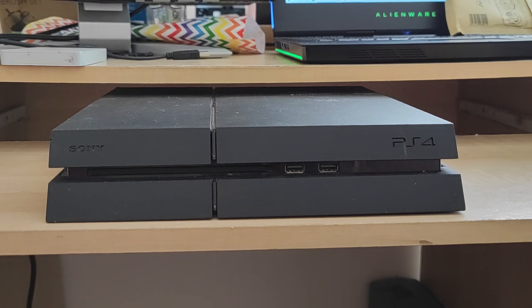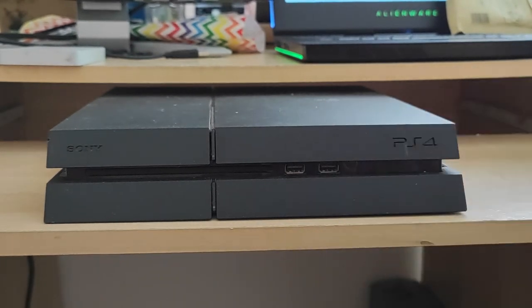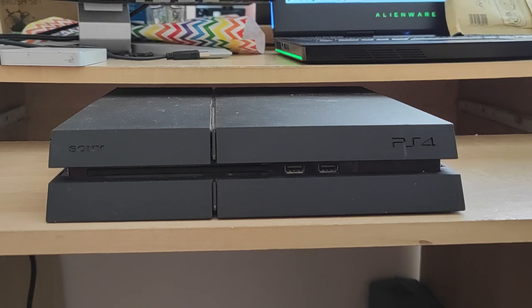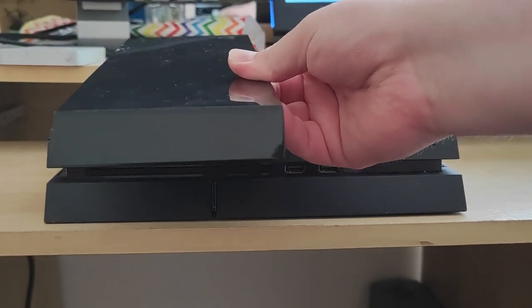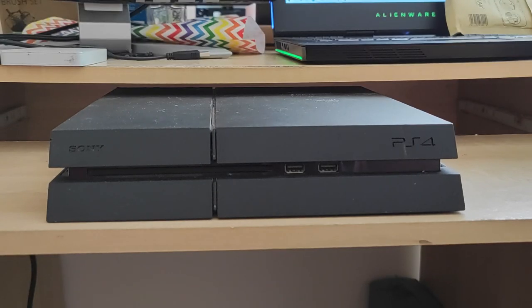A lot of the time people are following the wrong disassembly guides — they're following guides for the 1200 series machines when in fact they want to be following guides for the 1100 series machines. Back when these were new it was easy to identify a 1200 series machine because the top hard disk drive covers were matte black plastic, the same finish as the rest of the console. On the earlier 1100 series machines they had a shiny glossy black plastic lid. Unfortunately enough time has passed that these machines have wound their way second and third hand through Gumtree, Facebook Marketplace and eBay, and bits have been swapped around. Because these tops are completely interchangeable, there are 1100 series consoles with matte black tops and 1200 series machines with glossy caps — so now you can't really tell.